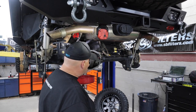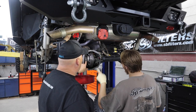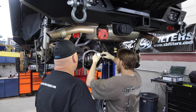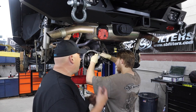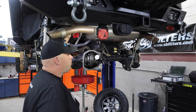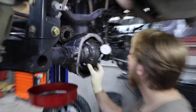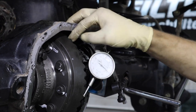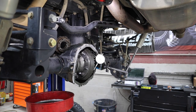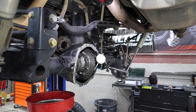Just like the front guys — you can't mix up these caps, and all the shims and everything are different sizes. You can flip this upside down but there's an error if you're not following it carefully — that's why I had to put a disclaimer at the bottom of the videos. Think we're going to hit spec first go around? Three-six is where we've got to be. First go-around — we're over. We are at eight, so we have too much. Too much on the back and not enough on the front for the factory shims. Now here's the game where you've got to take the carrier back out, put some other shims in, and keep going back and forth until you hit the happy medium and are in spec.